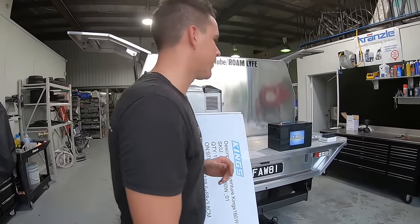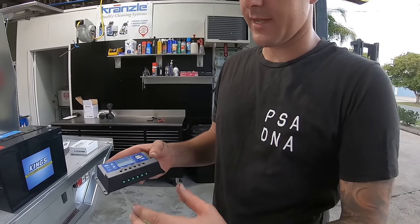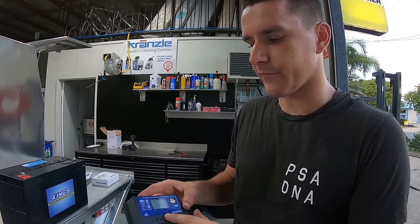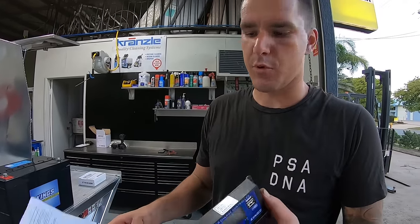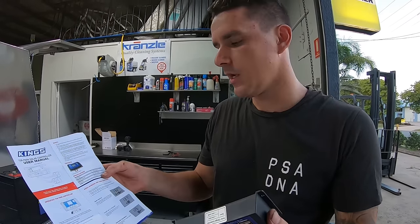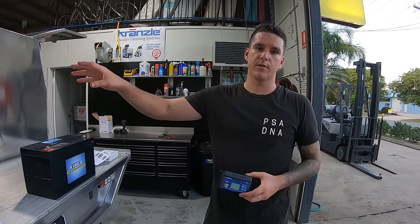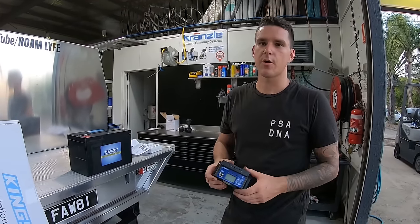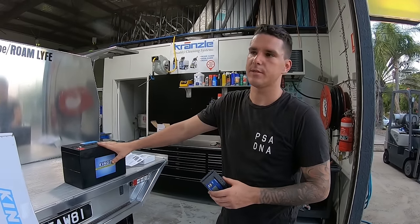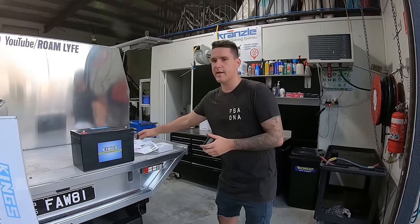So either the regulator's dead or the solar panel itself is dead. I've bought a new solar panel and a better regulator. This new one is a bit different — the other one had wires coming out that you had to solder onto, whereas this one you just bring wires up the back and screw them in with a Phillips or flathead. It's got a lot more information on it: battery voltage, what the solar panel's putting in, and the state of charge, which is very important. The voltmeter I currently have in the cab is just a voltmeter and doesn't show how much power has been put back into the battery.